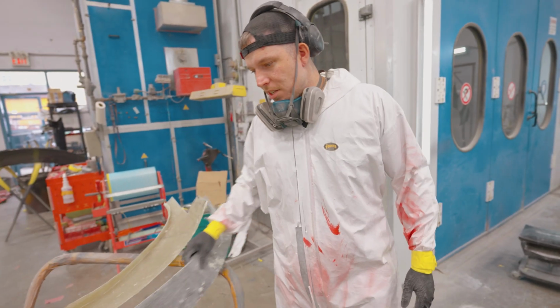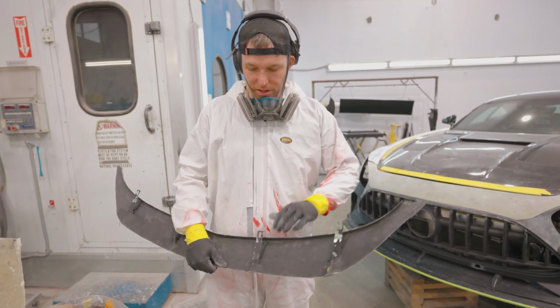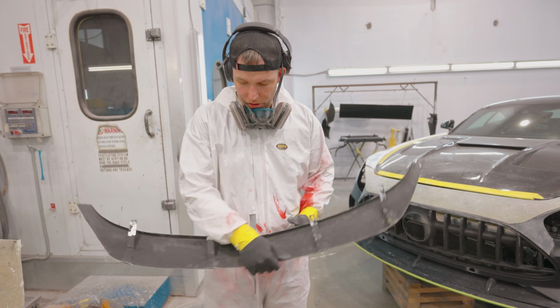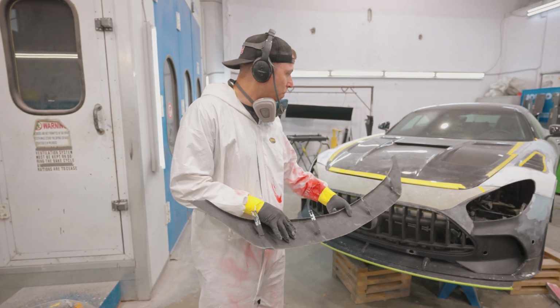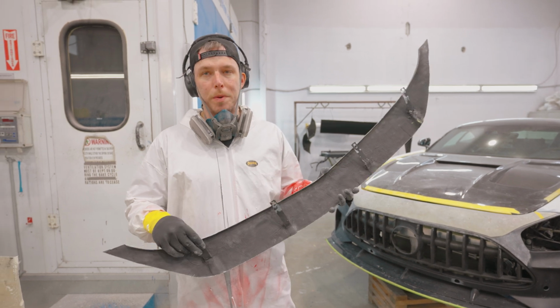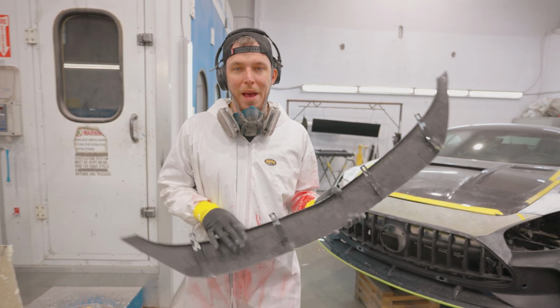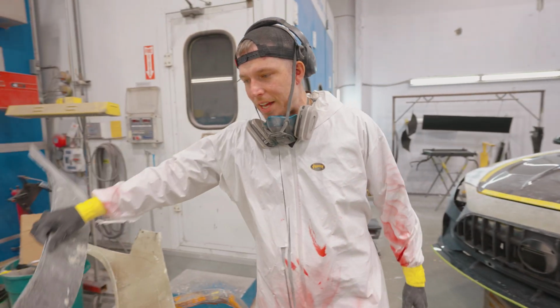It's just some really thin sheet metal that has no strength at all. So once this gets bonded together, I'll make some new brackets out of probably 1/16 aluminum. I'll bend them up to the shape that's required, and then we'll do our panel bonding and reinforcing with some fiberglass. Don't buy cheap body kits.